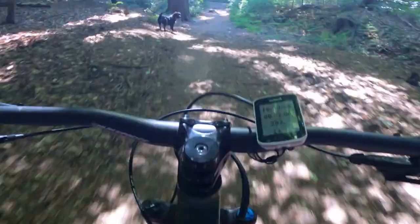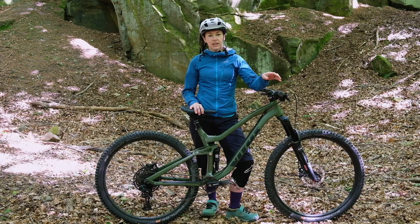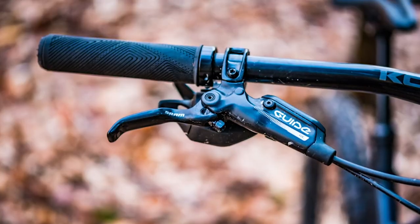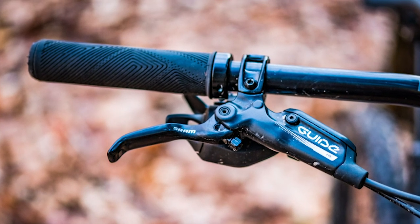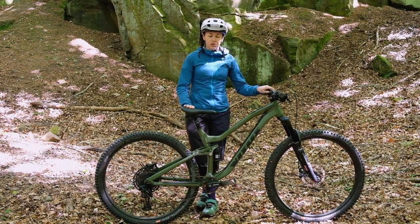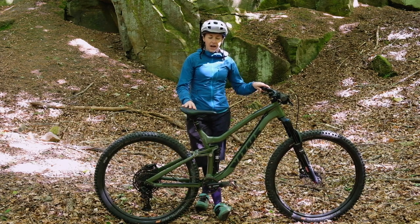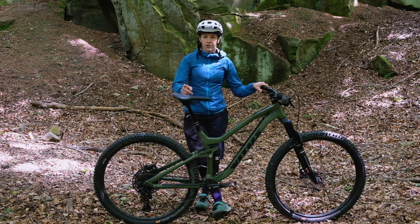All in all, this really is an all-round package — a bike that will go on XC missions and ride trails, and is easily upgradable in the future. If £1,500 is your ceiling price but there might be wiggle room later, it's a really good one to look at. Things I'd change first: brakes — I'd get a more powerful set. Something like a pair of SRAM Guide REs — a four-pot brake for around £80 — would be a great upgrade. The other niggle is the lack of dropper post insertion; there are shorter-overall dropper posts that might allow you to fit a 150mm drop.